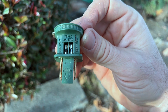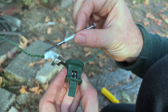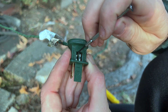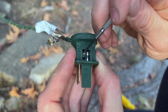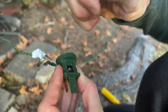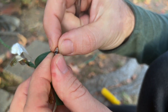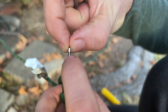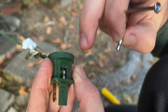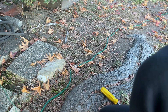We're going to go ahead and replace that. Now to get this little fuse out, I've got just a little screwdriver for eyeglasses, but you could use a needle — anything small enough to get in there and pry that out. There it goes. See that, just tilted it loose. Let's go ahead and pull that out with our fingers now. There it is. You can see it's all dark in there, so this is most likely the one that's blown out. The blown fuse — I'll set that aside.